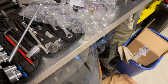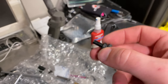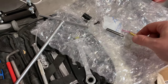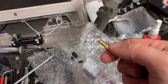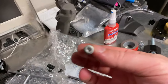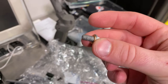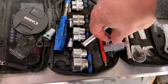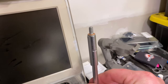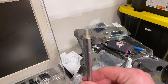They give you two options: you can use a hose in combination with this plug — slide it onto a hose and then slide it on there. But I couldn't get a zip tie in there cleanly. So I grabbed one of my OEM bolts — it has the same thread. They give you one, but I'd lost it. It's a 6mm. I did use their copper washer, and luckily the head is also 8mm. I put that in there and that's the fix for plugging that up. If you don't plug the hole, you will have a leak of some sort, so don't ignore that step.